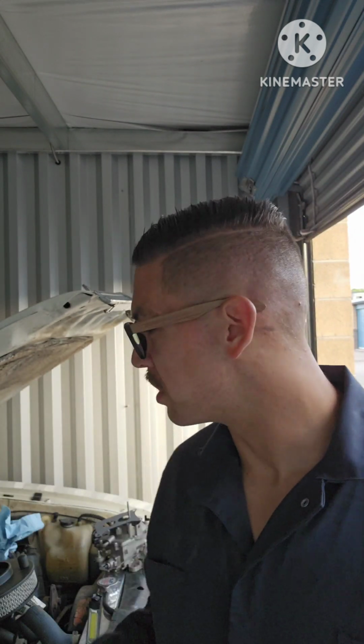So we'll see. I'm gonna have to retune it. The carburetor just needed a rebuild. It was in poor shape. I had varnish on it and everything leaking. It wasn't even bolted all the way down at the base correctly, so there's vacuum leaks there. So we'll see how that goes. We'll get it all bolted back on and we'll tune it, go from there.